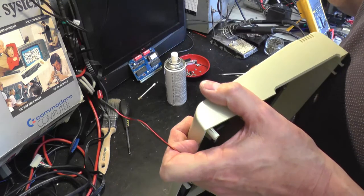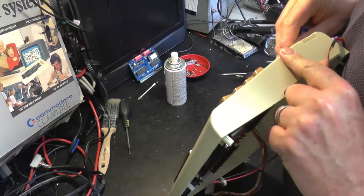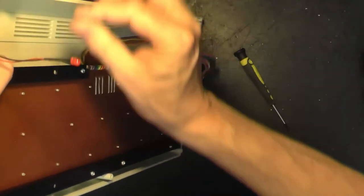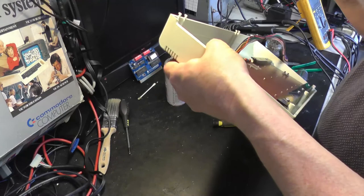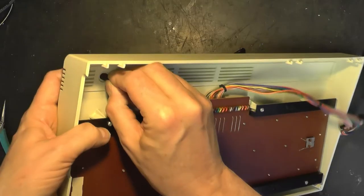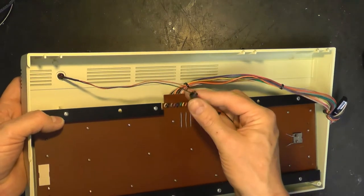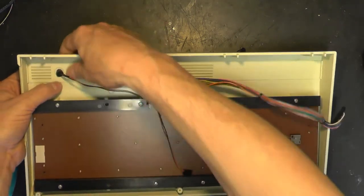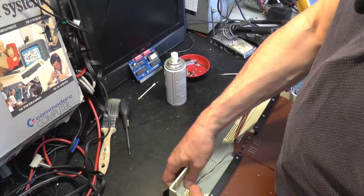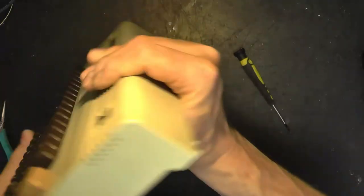Reassembly of the LED. Here's the bezel. So snick the bezel in the hole. Just push through there. It will fall out. Get the LED and pop that in the back of there until it comes through like that. There we go. The locking ring is still on our lead from before. That then drops down, and with a bit of persuasion, we'll lock the LED into place on the front panel. There. Terrific.